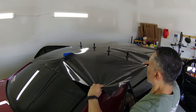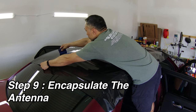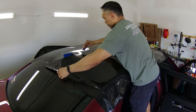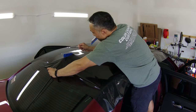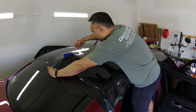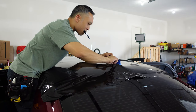To actually wrap around the antenna, I like to use a technique called encapsulation. This is where you effectively create a bubble around the object you're wrapping to isolate it off from the rest of the vinyl, as you see me doing here. This sets you up to tackle that particular area — in this case around the antenna — and then you can apply the rest of the vinyl, which will be much easier later on, across the flat parts of the roof.